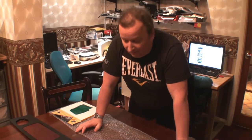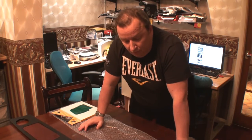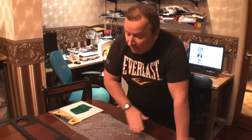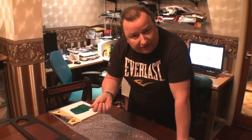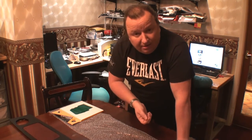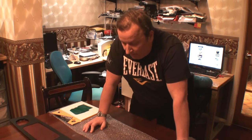They know the formula. There are so many variables at the moment with regards to the activator spray, that's the aerosol spray we spray on, how long you leave the actual film in the water, the water temperature, the window between once you've sprayed that activator, when to dip, and the actual transfer film you've got. Again, I got it from two totally different suppliers, so them two films may not be compatible. So we're not giving up on this.